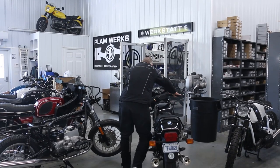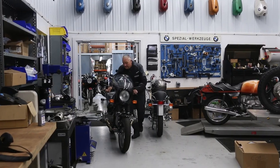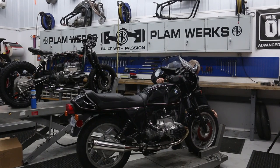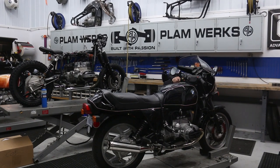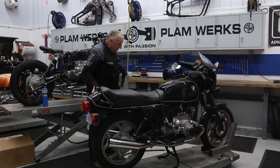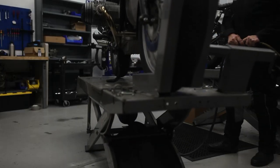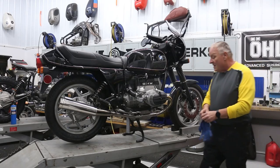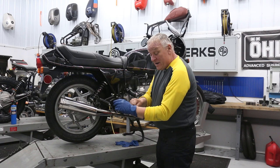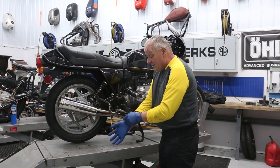The suspension is good, the motor's really strong, the brakes work great — just the whole thing was amazing. We even put the SP Connect phone mount on there. Now we're going to take that into the shop, get the oil drained, let it cool a bit, then retorque the heads and adjust the valves. We're hot off the road — had a nice little extra ride this morning. I want to get the oil out fully at operating temperature as much as possible since we just rolled in and it's still nice and hot.